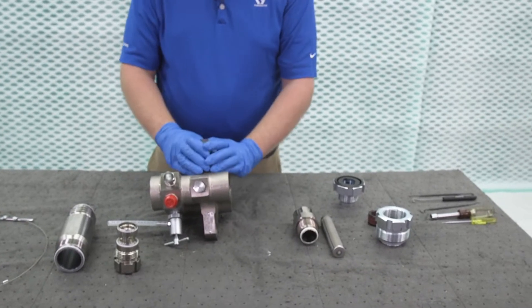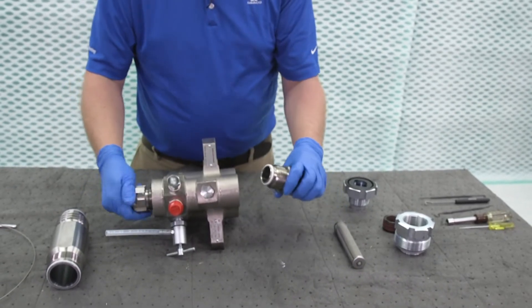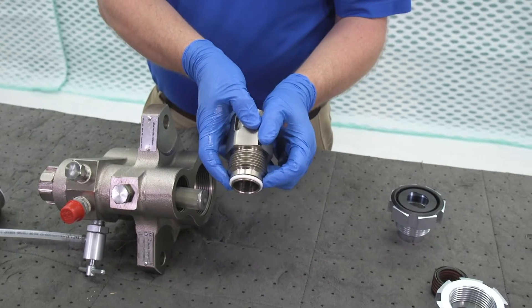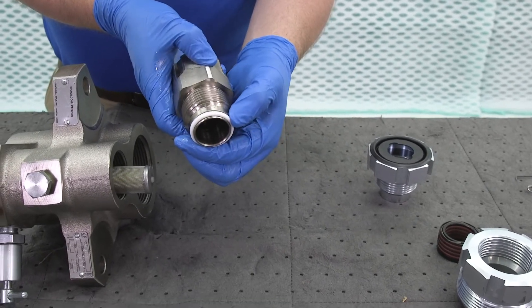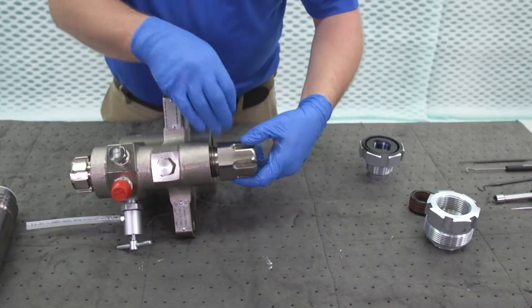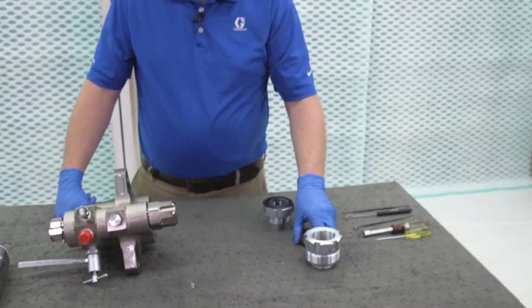You can start one of two ways — I'll do the way I normally do. We'll start with the filter housing. We'll put our new PTFE O-rings on here. One thing to note: typically when you get to the top cover for the filter housing, that's the one that gets used quite a bit — people are in and out of this one — so note how thick that O-ring is. Because it's PTFE, it doesn't have a lot of memory, so with the larger O-ring you'll be able to reuse it several more times than the older version. As I'm putting things back together, depending on the material you're pumping, I'll normally put some type of anti-seize on those threads so when we do have to go back and take it apart it's going to be a lot easier, especially when you extend the pot life of the material and try to rebuild that lower.